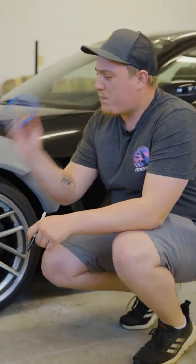If you've been thinking about wide-bodying your car, here are some tips and tools that you're gonna need along the way. First things first, you're gonna wanna grab a bunch of blue painter's tape and a Sharpie, cover the whole panel with the tape, put your piece up there, and trace out the outline.